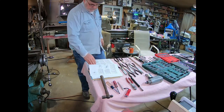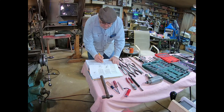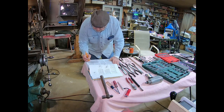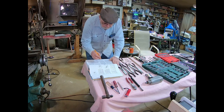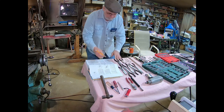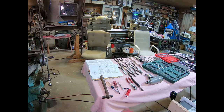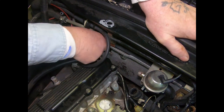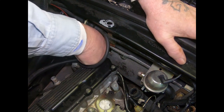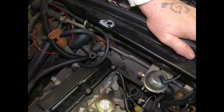Okay, guys. Let's see where we're at with this thing. Disconnect starter solenoid and starter motor feed cables from bulkhead connector 26. That's gotta be right. Okay. Let's get that done. Well, it's definitely a tight spot. Why ain't that going on down? Won't slide out.